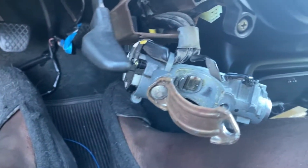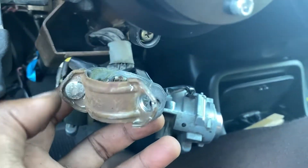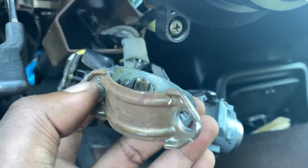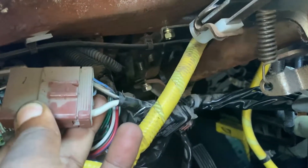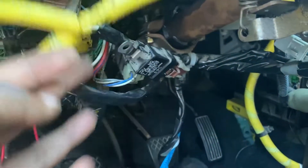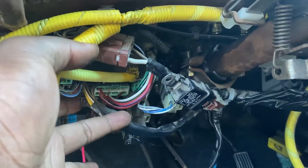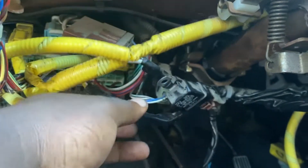I don't think the guys at JDI expected this to happen. I was hammering this side and I guess I should have left the other one in — it spun the whole column and then bent the bracket. You need to unplug the harness — it'll have this one and another one right down here. Unplug those two, and this whole thing as an assembly just comes out.